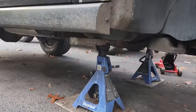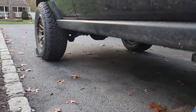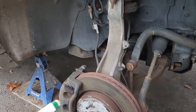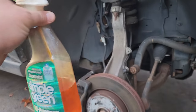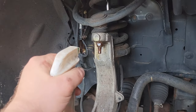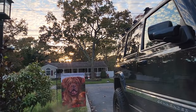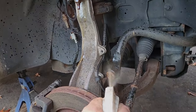All right, we got this baby jacked up, nice and safe. We also got it blocked, don't want it to roll. The e-brake is also on. Now what we're gonna do is we're gonna take some PB Blaster. This is some Blaster, it is not Simple Green. I just put it in a better sprayer bottle, and I'm going to soak every single joint and then let her sit and soak and come back tomorrow. It is getting dark, so soak on, and I'll see you in the morning.